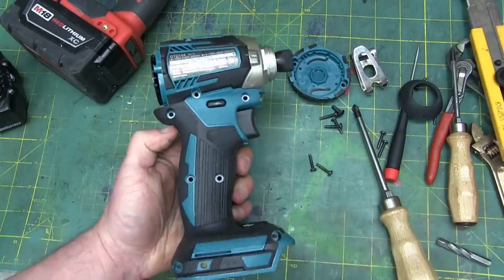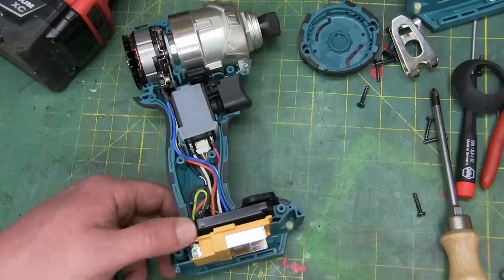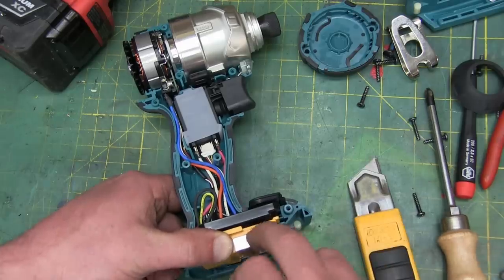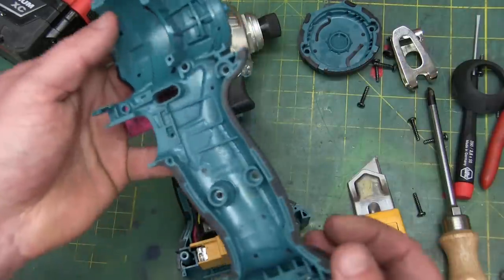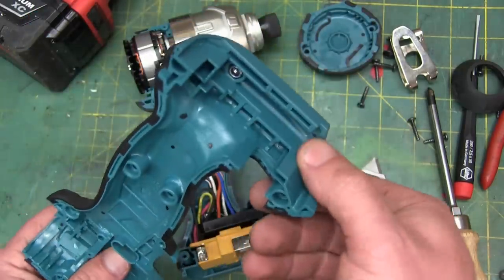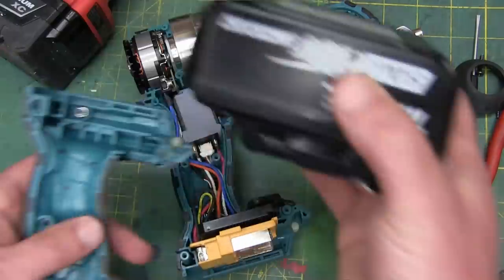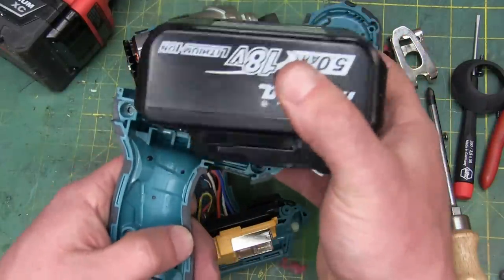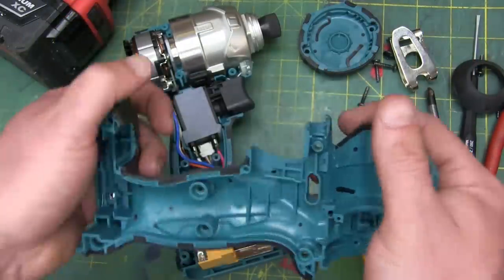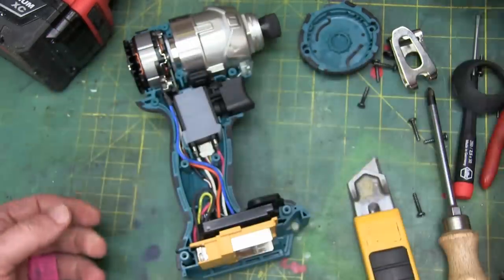Look at this. It's a little bit beyond the beyonds here. Starting at the beginning, we have the leads, chrome plated copper, nice leads. Here's the half clamshell, PA6, glass fiber reinforced 30%. These UHMW little pins are for retaining. They're to prevent the battery from rattling loose. That was apparently a problem in the older Makita tools, and they've gone and fixed that with that little guy.